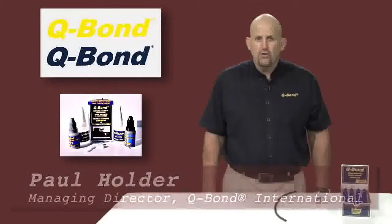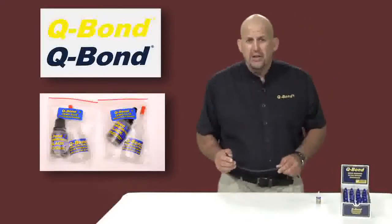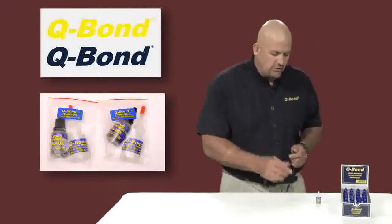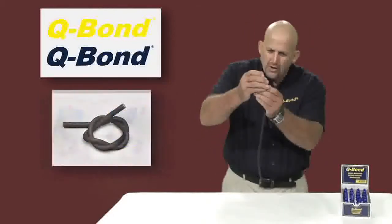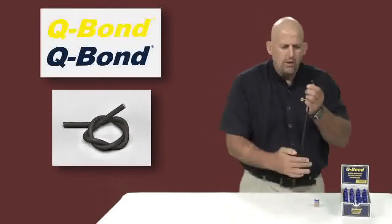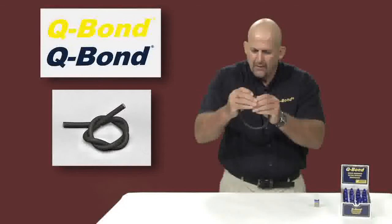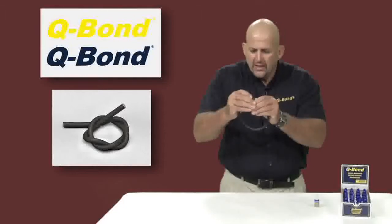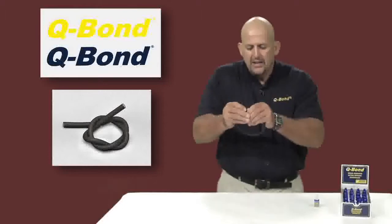Today I'm going to show you how you can benefit by using our quality Q-Bond adhesive. The first thing that I'm going to do is use some of the Q-Bond. I'm going to apply it onto a new neoprene rubber surface. We just use a very small amount of it at a time, and we take these two parts and put them together. It's very important that those two pieces are 100% clean and dry.